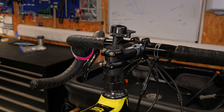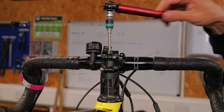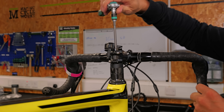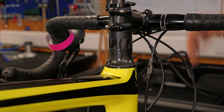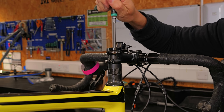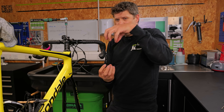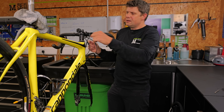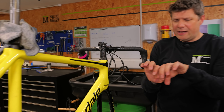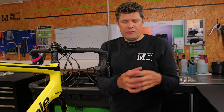We've just about got enough clearance at the top. With Cannondale, we need to set this compression section in line with the bottom bolt — and this needs to be torqued to four newton meters. Then we use a five millimeter on the top cap to set our bearing preload as normal. Tighten this down enough so these can no longer rotate — at the moment it's still rotating, so tighten until all that rotation is taken out but the headset still freely rotates. That tells you everything is compressing and locking onto that ring. Put the wheel in, straighten it out, do the pinch bolts — knowing there's a compression bung on the inside pushing out on the carbon. With carbon forks, you need to tighten more than you think to make sure that compression ring is actually gripping the fork. If it isn't, you're going to end up with a Ring of Death.